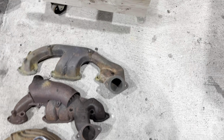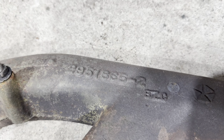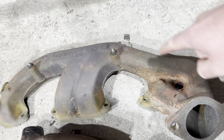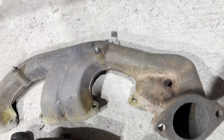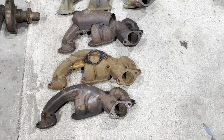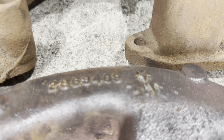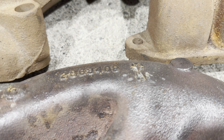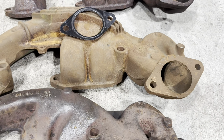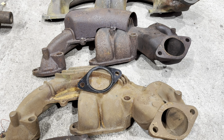Now I'm going to show you the difference in exhaust manifolds. Right here is a B-body exhaust manifold - the part number right there is 2951866. It's a fairly conventional HP, kind of goes up and down and out like that. The C-body ones have a different kink on them to basically clear the torsion bar. So I've got three different exhaust manifolds here. This is the 68-69 version, part number 2863409, where it goes out at a different angle than the B-body one. And then in '70 they changed the angle slightly, I think for better exhaust routing.